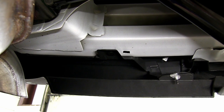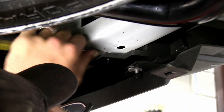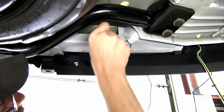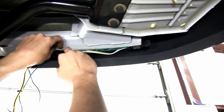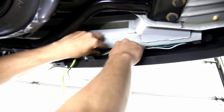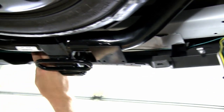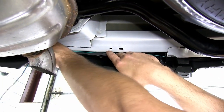For this application, we'll go ahead and remove the two push pin fasteners securing some of the underbody trim panels so that we can tuck our wire up underneath, safely securing it. Now with our fasteners removed, let's go ahead and start routing our wires. As you route your wires, be mindful of excessive heat such as exhaust or moving components such as steering or suspension. The four pole connector will come out from underneath the bumper fascia towards the center so it can be routed over to the hitch, while our green wire will get tucked up underneath the underbody trim panels and be routed all the way over to the passenger side.